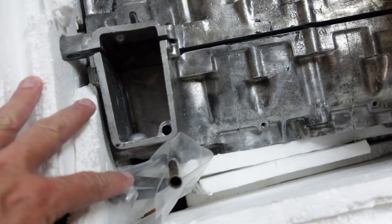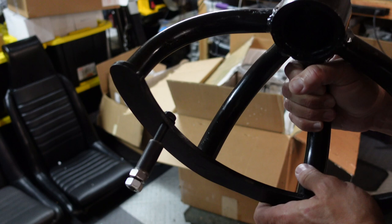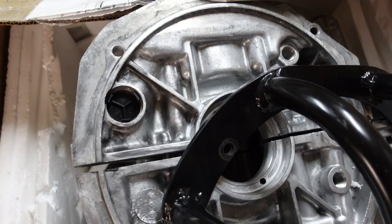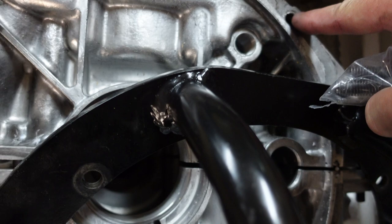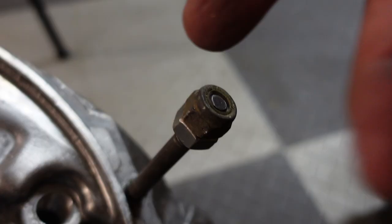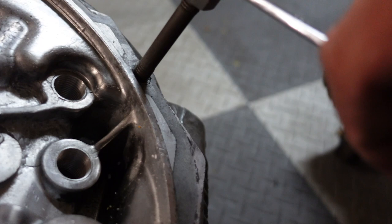Let's get this on the stand. Here's the yoke — it's designed for a Type 4 engine and probably other Volkswagen engines too, but gives you a lot of space. You can work in and around it, even do a clutch job with this kind of yoke. The studs are out of the case because George needed to work on them, so I'll put them back in first because I need those to attach the yoke. I just double-nutted this and I'm going to put the stud back into the case.